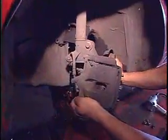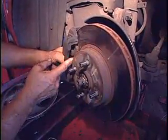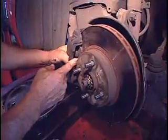We need to inspect the brakes. First, make sure there's no leaks in the caliper. Look for moisture around the caliper area. Look for cracking in the hoses. Make sure they're nice and dry. Next, we want to look at the brake lining — make sure they're worn evenly. We want to make sure the caliper is not loose in its bracket.